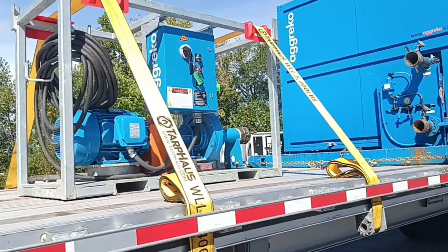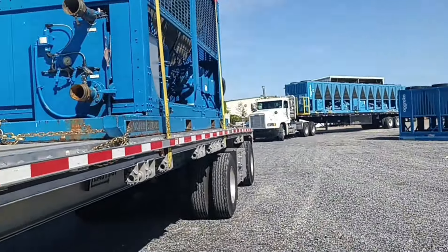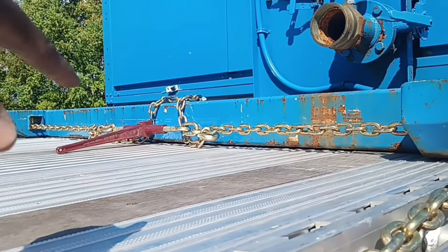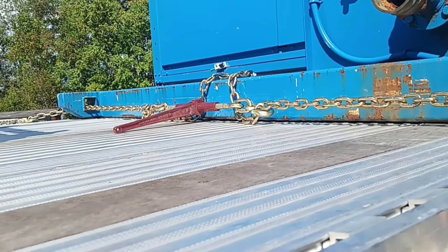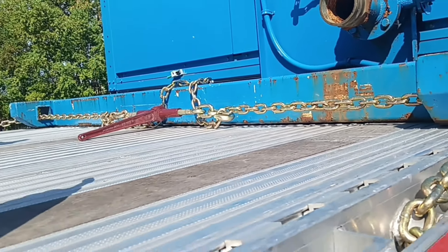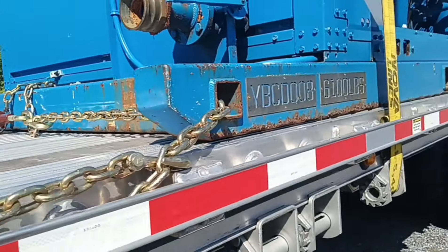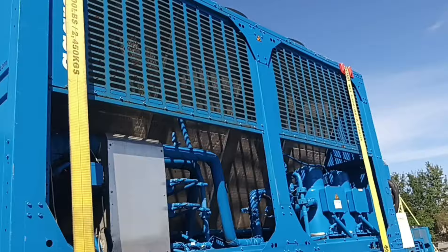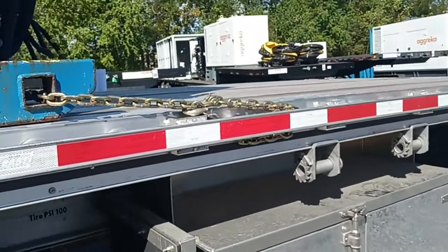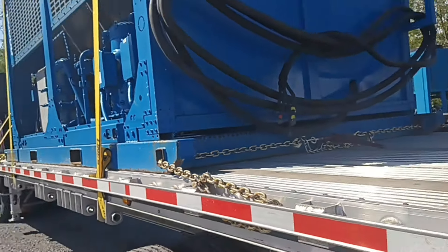I just secured the load. There was a next piece near the truck, so I had to strap that in as well. With trucks coming in, I had to get out of the way quickly. I used one of the chains and one of the ratchet binders to strap the front down. This chain is pulling to the front, and I also had two straps for extra securement. The chain at the back is pulling backwards — all tight.